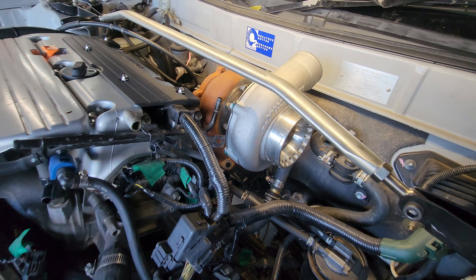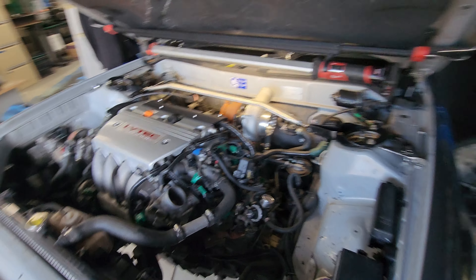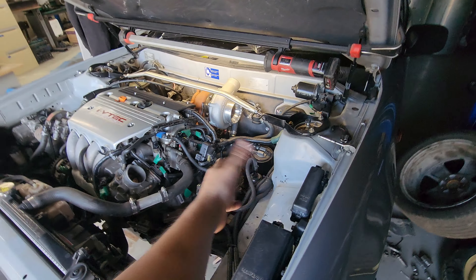A bit of a funny story - this is not really where I wanted this turbo. I wanted it facing sort of this way, like this bit at the front coming this way so I could run it straight out the headlight hole if I went to the drags. But it fits really well back there. I've removed the airbox and a few bits and pieces but most of that could go straight back in. If I had the current manifold and put two 90-degrees on it, pretty much straight up, we're done - and there's enough room for the exhaust to come across the back of the engine.